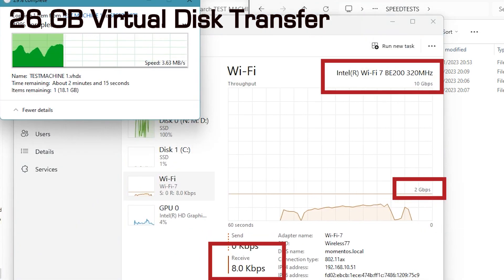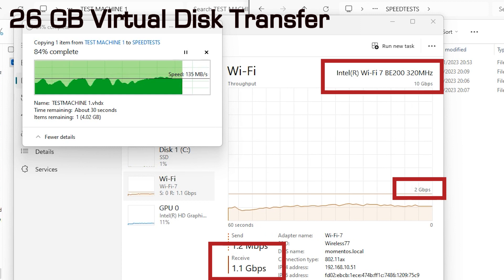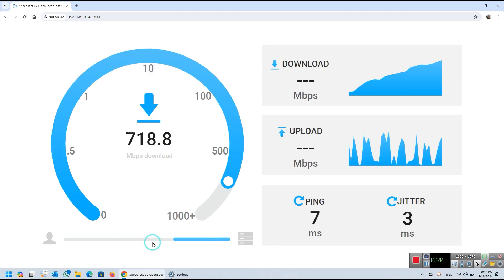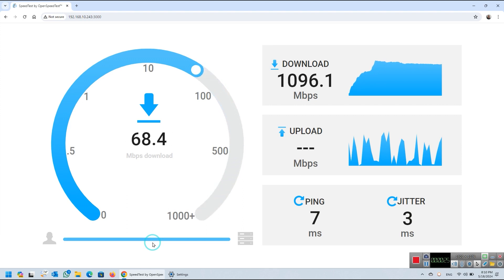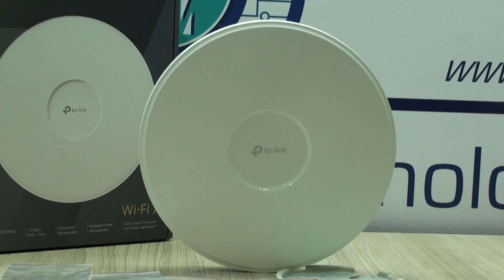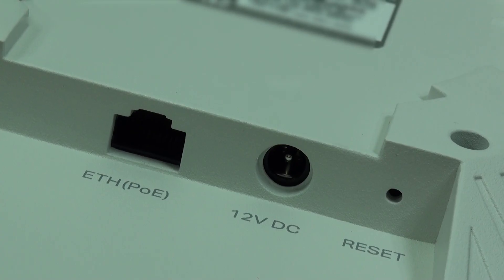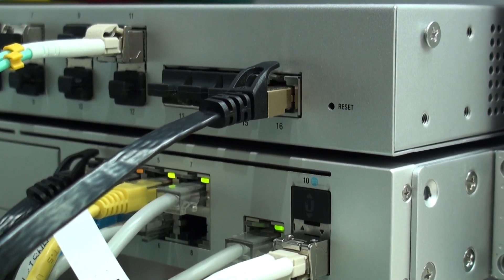What we are saying about being realistic is: you buy, you connect, and you use it — that's what most users are going to do. However, even though we tried tweaking the access point, let's remember that the default settings for large infrastructure access points like this one are oriented for high density but lower speeds. There were not many differences, and we stayed in several continuous tests a little above 1 gigabit per second. Being honest, it is the first time that out of the box a Wi-Fi connection has taken me above 1 gigabit per second, which I never thought possible. Network cards and access points are managing connections automatically — things like bandwidth and channel — and it is basically using the 6 GHz connection. This means the access point is using only one of its radios, but more on that in a video about this fantastic access point, which features a 10 gigabit per second uplink supported by a Power over Ethernet++ optional connection.